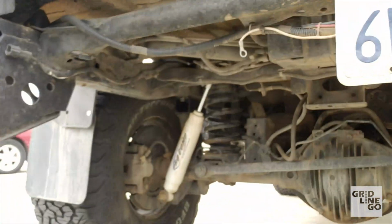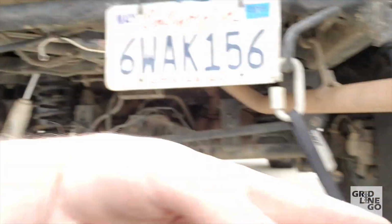I didn't want to do these extensions anyways, but it's really to help the wheels and tires from getting stuck up in the fender and locking, because what was happening was it was actually locking up on one side and shooting the power out the other side, and I was not getting anywhere with that until I started yanking up on the e-brake a little bit to lock up the other side to power through that side, and kind of chaotic. So I want to keep those tires out of the fender wells and rotating as freely as possible.